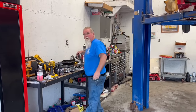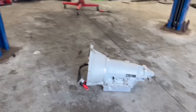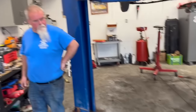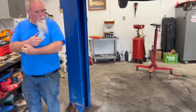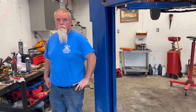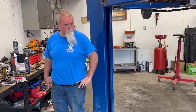This is torque converter lockup for dummies — and when I say dummies, I mean us, because we never messed with lockup torque converter stuff. Donald bought this transmission used. It's a Mark Mickey transmission, non-lockup but built for lockup so it could be either one. Ideally if you buy the converter and transmission all together at one time, you get all the right stuff.